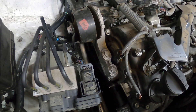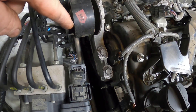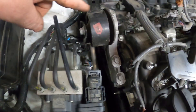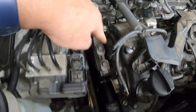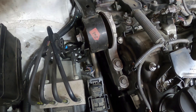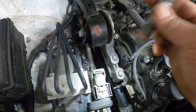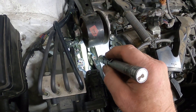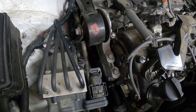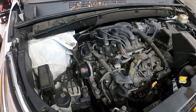Here's a little bonus footage for you. You can hear it — it's no longer making that noise it was making in the beginning of the video. Next time when I do one of these, I'm definitely going to jack the engine up first and remove all this stuff, then take that lower bracketry — it's much easier that way. But this one is good to go. Water pump is no longer making noise, the pulley is no longer shaking. When you hear that noise, you can physically reach down and push on a pulley and the pulley will deflect like this. Alright everybody, just to show you a little bonus footage — thanks again for watching.